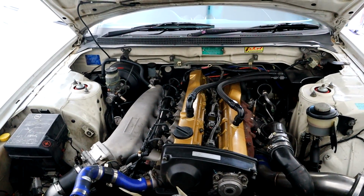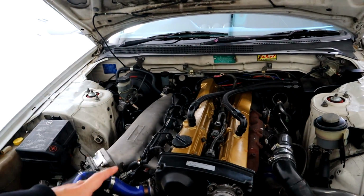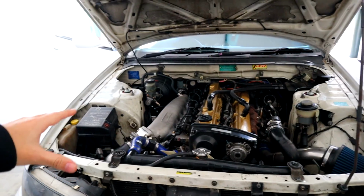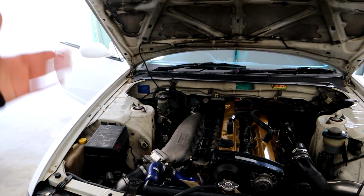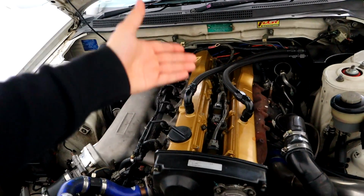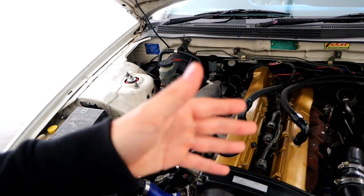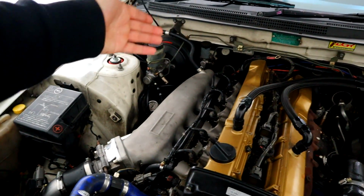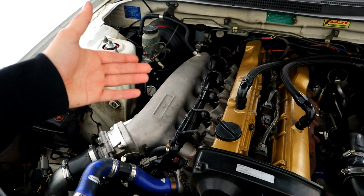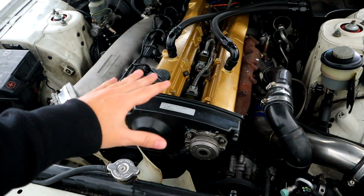So on the RB25s, there's one point of failure for the whole trigger setup, if you're experiencing issues with, like, let's say cold start or something misfiring. I know for a fact that all the coil packs are working because up high they all fire absolutely perfectly. The spark plugs, nothing misfires. Plus I've individually tested each one of them on the Link system, so I know they're okay. However, the CAS is the only thing that I haven't changed on this car.